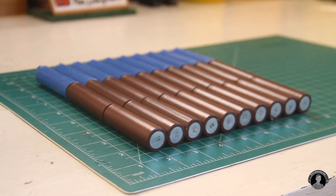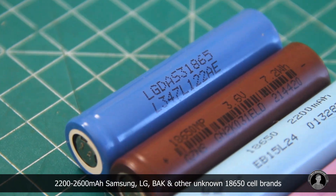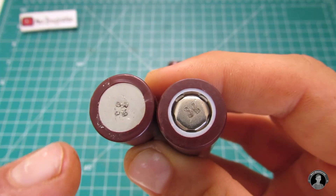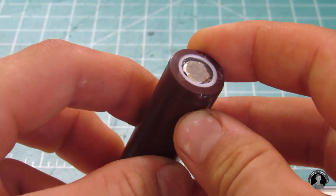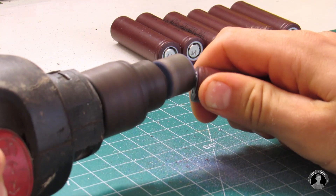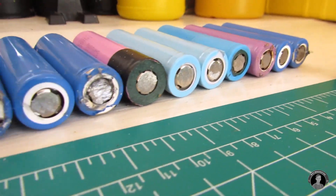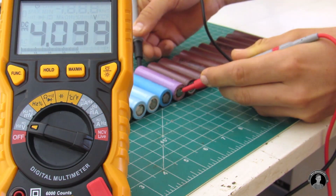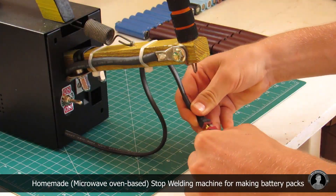Just look at this pool of recycled lithium-ion cells. My battery pack will consist of recycled cells from five different brands but with very similar capacities. Before welding the cells together, you'll want to remove the tab welding marks that remain on all of the recycled cells. Once you've done all 35 of them, test that all 35 batteries are charged up and maintain a similar maximum voltage. Here's the battery spot welding machine I showed you how to make in my second to last video.